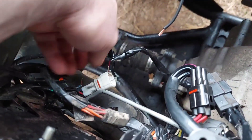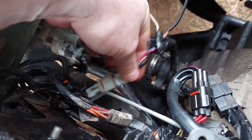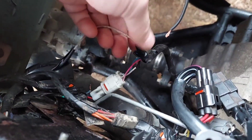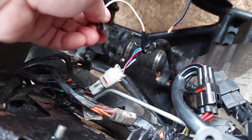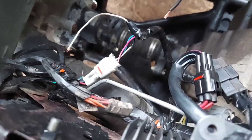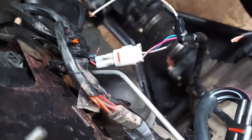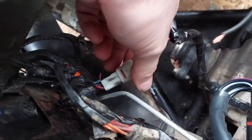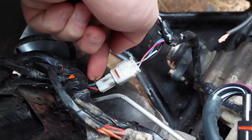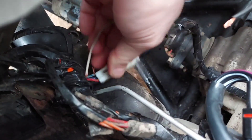That's why it was hitting a rev limiter — because it's broken. All I did was jumper the wire: cut it off on the side, added a wire, and connected it. The ATV runs great — no stuttering, no popping, no backfiring, it runs like new. Sometimes it all comes down to checking over your wiring really well. If you suspect this may be the issue, you might want to just bypass this whole thing, because something caused that wire to break — probably just vibration from age.